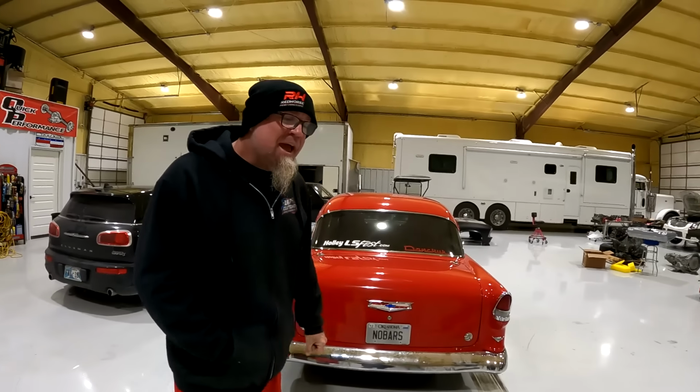And honestly, a stock converter is somewhere in the middle if you're going to roll race. That converter that he has is loose. There's no doubt about it. Honestly, if that truck made more horsepower, the stock converter would probably be better. But with the horsepower it makes, I feel like he's going to be real disappointed in that stock converter. Yeah, got to learn things on his own. Live and learn, man.